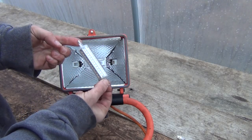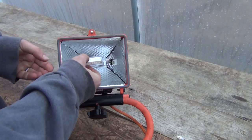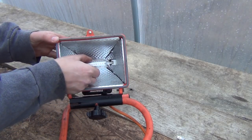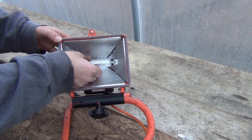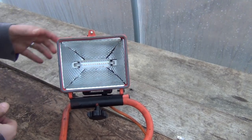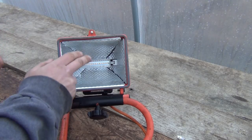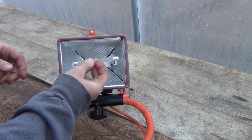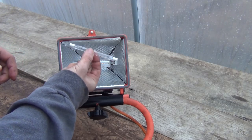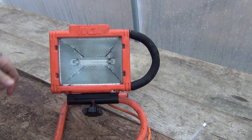They're all enclosed, which is nice — way less heat — and they are an exact replacement. They fit right in here on one of the posts on one side and just push into place. That's it. It's super easy, a direct replacement for those halogen bulbs. You can put these in anything that takes these — I want to say they're 4.6 or 4.7 inch — anything that takes these halogen bulbs you can replace with these LEDs.